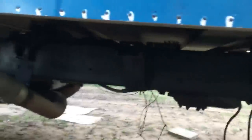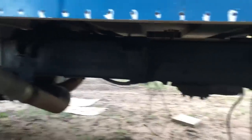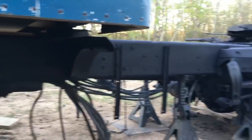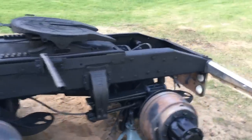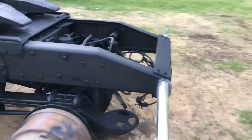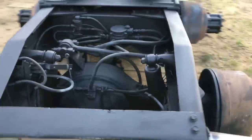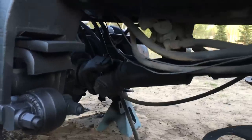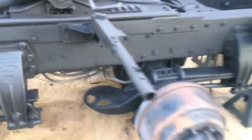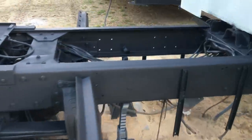Other than that, I haven't done anything on the inside yet, but I've done a lot of work outside on the frame. I sandblasted the whole thing and primed and painted it — went flat black, kind of like that, doesn't show dirt as much. Went all the way around underneath. There's a lot of work to get under there — drive shafts and the diffs — cleaned those all up, so she is ready for reassembly.